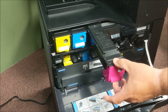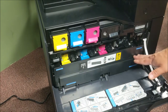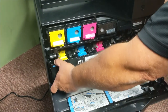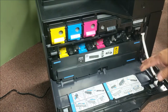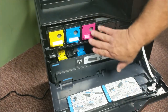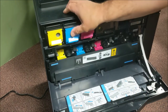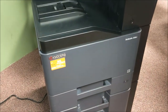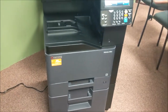You just lift up and notice it pops out, then you're back in place. You also have a waste container here — indicated by the blue markers — and that will pop out. That's your waste toner, and it will last about 40,000 copies, so it takes a long time to fill up. There's your yellow, cyan, magenta, and black. Just pop up, slide out, and pop a new one in. If you cannot close the door back up, you did something wrong — open that door back up and reseat everything.